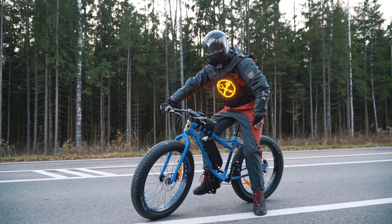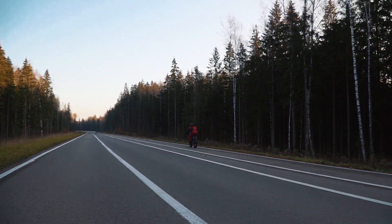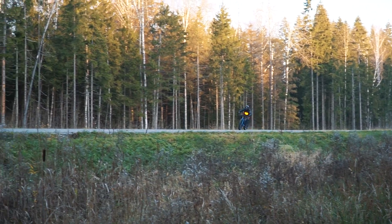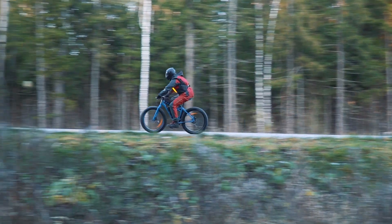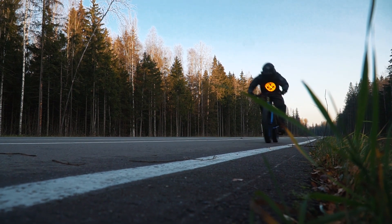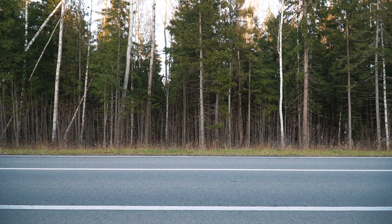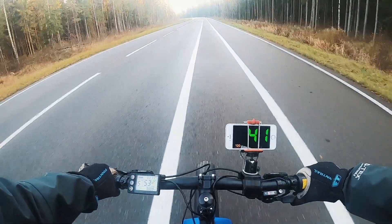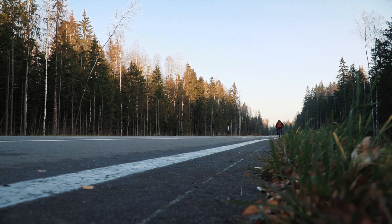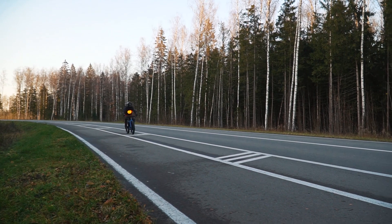All the assembling process took us about three hours, but we took our time — besides, the filming made it more complicated. It is getting dark now, but I think we still have enough time to test our bike. Actually we've got a fine electric fat bike with decent characteristics. It will be suitable for use in autumn and even in winter if we equip it with studded tires. The 750 watt reducer motor provides decent torque and acceleration. Our fat bike has a pleasant and neat look — nothing is dangling and trembling here. Let's check the maximum speed: the maximum result is 41 km per hour, a good result. As to the range — unfortunately we don't have enough time for this test now, but we made a range test with a similar bike the other day and the result was 45 kilometers, so I think you can count on about 40 kilometers.